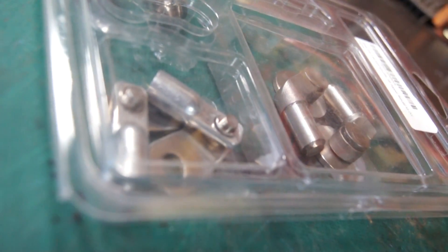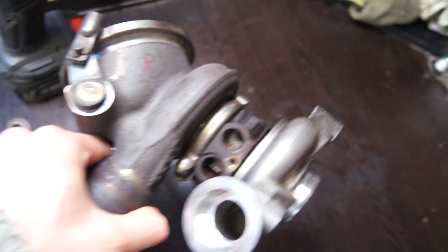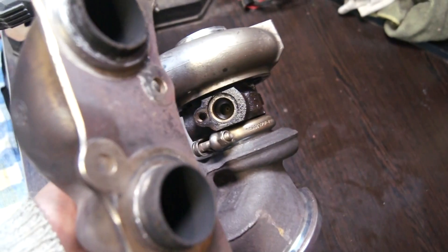What's up everyone, today I'm sorting out my N54's wastegate rattle issue for good. So far I've done the quick fix, which I have a video on here — this sorts out your rattle for maybe like 20,000 Ks, but inevitably it came back. So I went ahead and ordered a wastegate flapper repair kit. I didn't film the removal of the turbos, but it's a lot simpler than people make out. People say you need to remove the subframe, but you don't — however I did need to remove the right side engine mount to get up there.